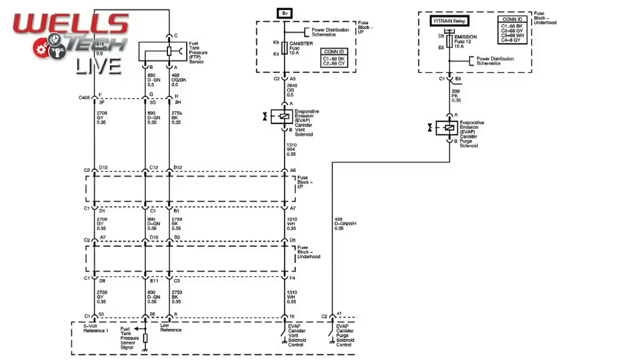Goes down to our computer, to the controller inside the computer. Right. So you can see that the computer actually controls that by sending it to ground. It's a switch. And if we look at the vent solenoid in the center, same deal, canister fuse, 10 amp, powers up our canister vent, and goes down to the control inside the computer as well.